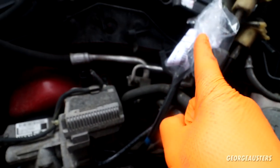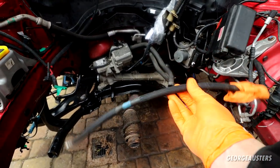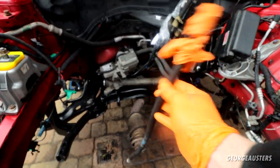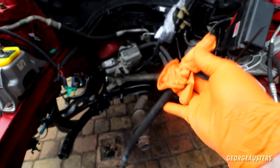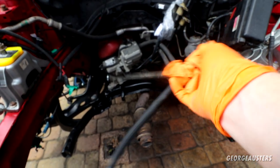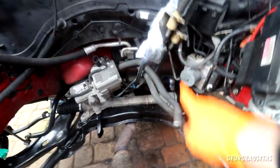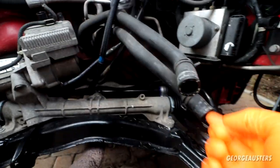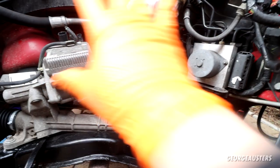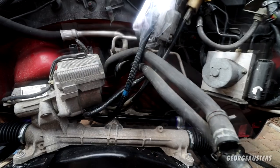This fuel hose has been replaced with a brand new one. The original was damaged at the end when the previous owner swapped out the high pressure fuel pump, so I didn't want to reuse one with a damaged end. The heater matrix has all been flushed through until we had clear water coming out, so there's no old coolant or debris left in the entire cooling system.